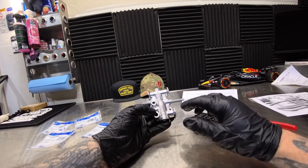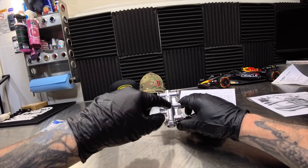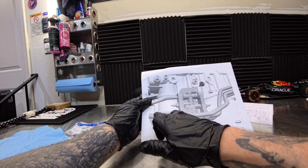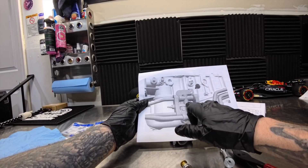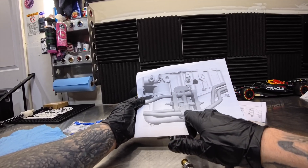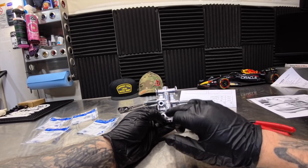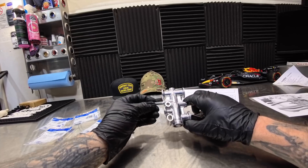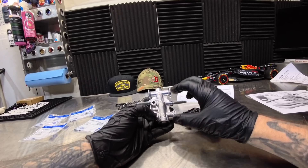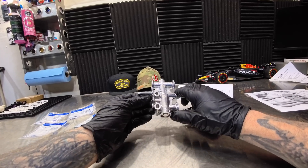What I want to point out is how this works. The fluid is going to flow through and it's actually going to loop back through here and go back through, and going this way is going to allow it to go to the cooler itself. Fluid actually comes from the transmission, goes in, loops back to the transmission. When the valve opens, it goes right through to the cooler. Now why would GM block this off so it's not going through the cooler? They don't want the fluid to be too cold — they want the temperatures to actually be high, one for fuel efficiency, and the other is so it'll burn off any condensation built up in the fluid.